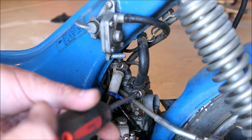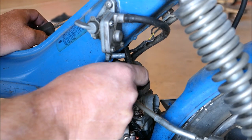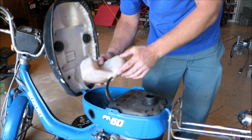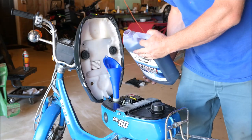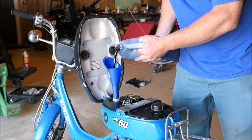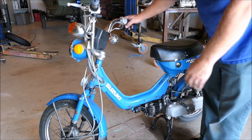I'm not going to clean the carburetor just yet. I have a feeling about this motorbike — it may not need it — but I'm going to replace all these lines. I don't like this filter crap on here. This line I want to replace and clean the tank out. Pre-mix and two-stroker oil because I'm not sure if the oil pump's working or not. It'll be okay if it's got a little extra oil to start with.